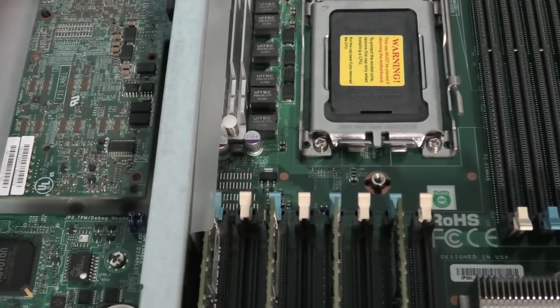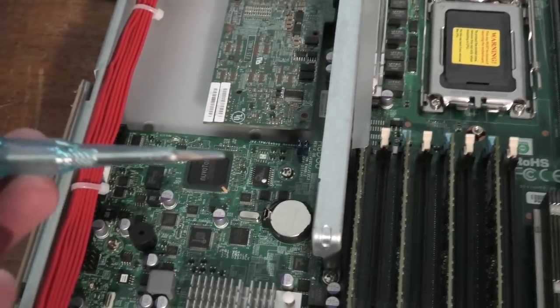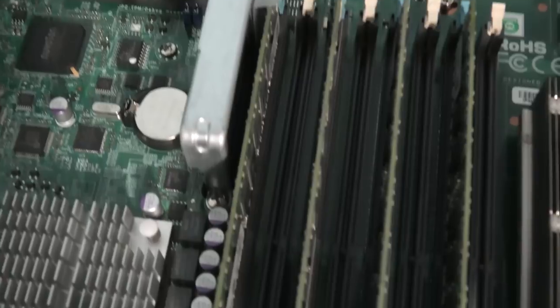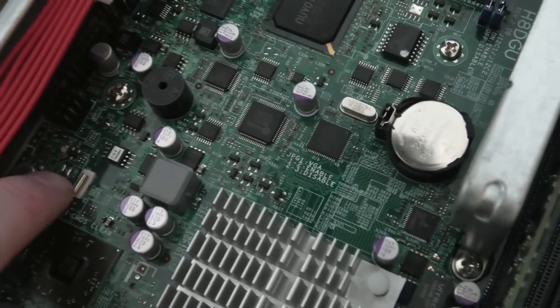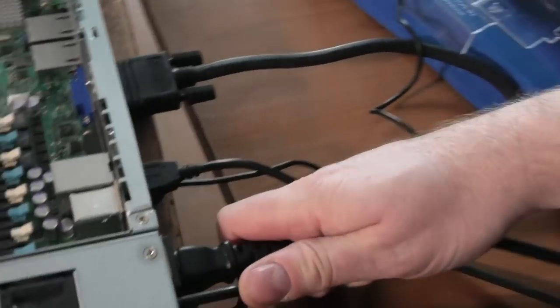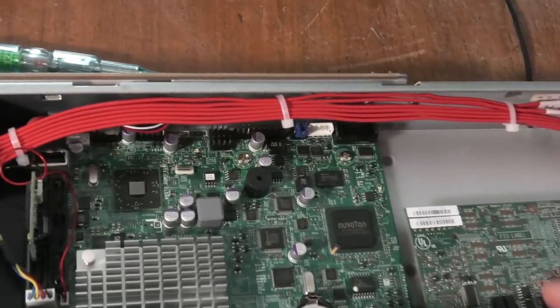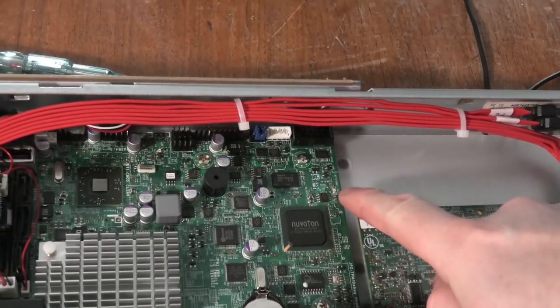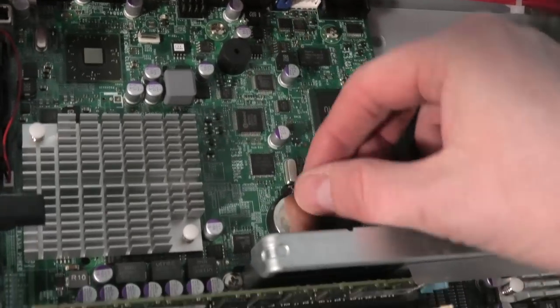I haven't turned off power yet. I have a little metal screwdriver here, because down here, there's two pads, and you have to short circuit those two. But first we have to disconnect power, which we'll disconnect here. And they suggest to take off the BIOS battery. You just want to have that stop blinking. There we are. And we'll take this one out.